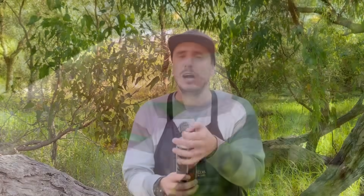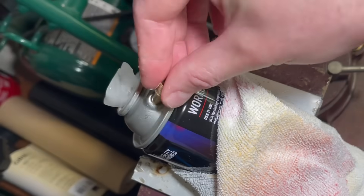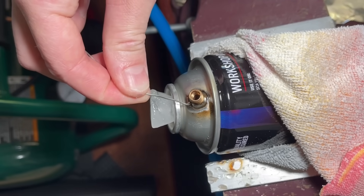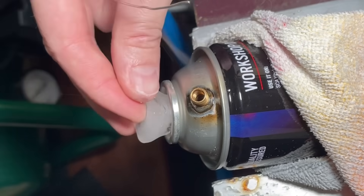I'm going to use an ice cube that I've drilled a pilot hole and reamed out, and I'm slipping it over the top of the can just to keep that area cold. Now that everything's nice and clean and fluxed, push the stem into the can and then use some propane or MAP gas — every few seconds move the heat away and just press the solder between the valve stem and the can itself, and eventually it will melt and absorb in. You don't want to heat the solder directly because you're going to get a cold joint.